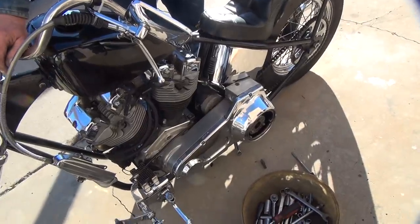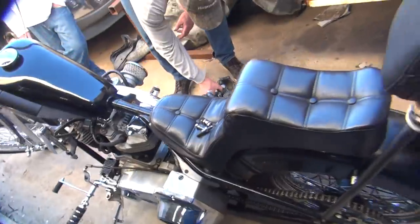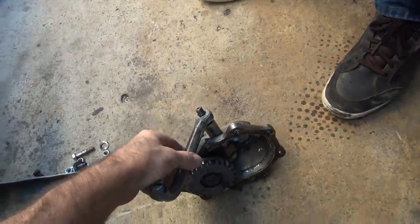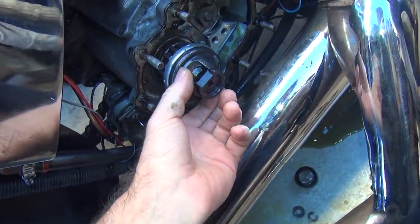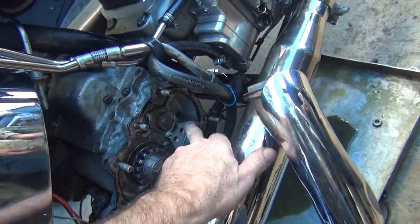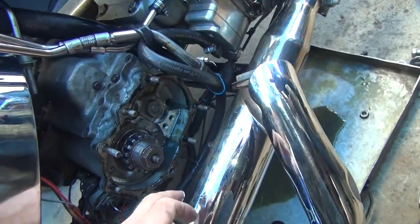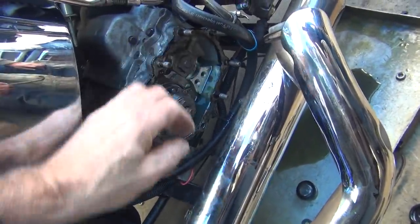Maybe I could limp home? No, I'm not limping anywhere. You've got to take that thing off right now. This cover? Yep. Alright, she's going to take that off. Here's the lever on the ground, the grinding I did for this. The threads are good on this, so the nut must be bad. So you have a kicker on this, yet you have no kicker stop. That's why your lever was way forward like that - in short time there will be a big gouge in the case, and the kicker will also re-engage, which will be a problem.